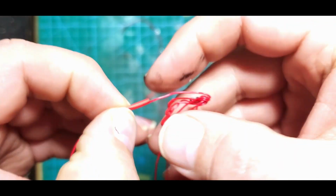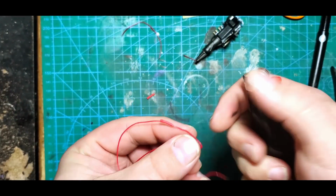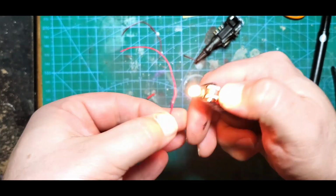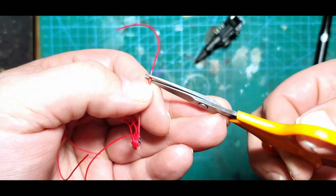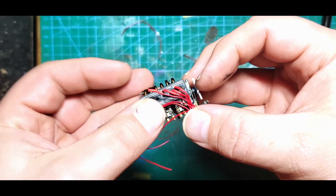Then we'll hit it with fire. I find that if I keep the tubing low down in the blue section of the flame, it doesn't smoke up and turn black as much, unless I'm just not real careful. Now we'll cut off the end and line it back up, and then make another small mark on the bottom and bend it to go into the valve cover.